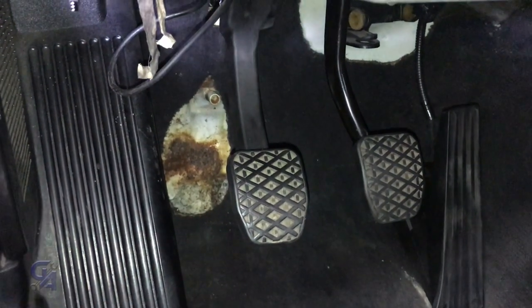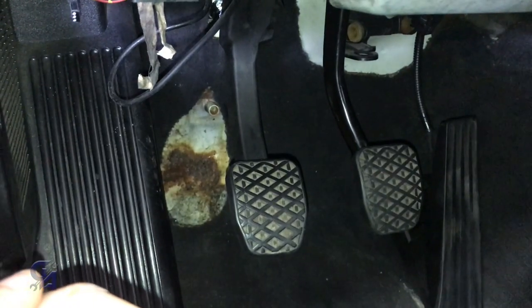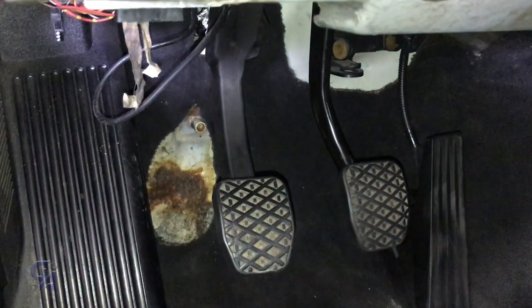All right, so let's go underneath the car. Let's get a vacuum bleeder on it. Let's suck as much air as we can from underneath and just cycle this over and over and over and make it a repetitive process.